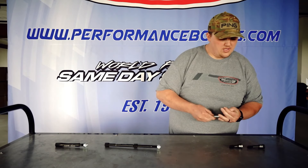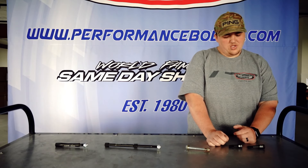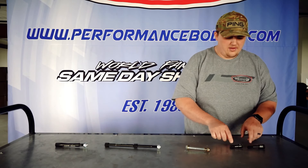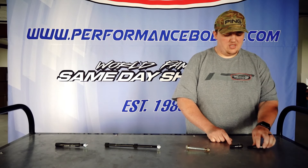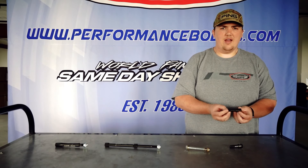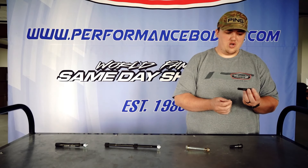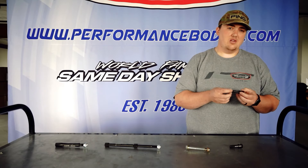Moving on to your shock bolts — this is a combination between the shock bolt and the shock pin. It has the spacer machined into it and then it has your hex head here. The difference between these two, while they do come in two different sizes, is the pointed ends. Again, good centerline measurement for your center to center. Put this in your lower shock mount and your upper shock mount, and you can measure from point to point to get a good center-to-center measurement on your shock.